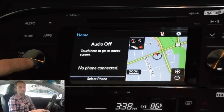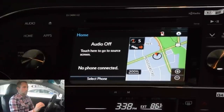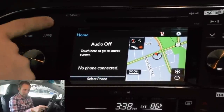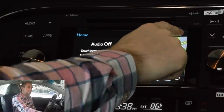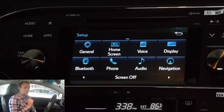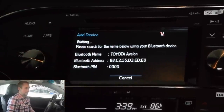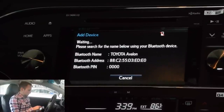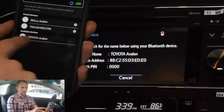All right guys, so first off we have the home screen here. We're going to be taking a look at this and working basically right from here, working off of this layout. If you ever want to go into the settings on the Entune system, it's actually going to be the cogs up in the upper right-hand corner through this Premium Audio Screen. Hit that button. We're going to be pairing the smartphone up now, so we're just going to hit Bluetooth. We're going to hit Add Device. We're then going to go into our phone, open up our Bluetooth settings, and search for a device.